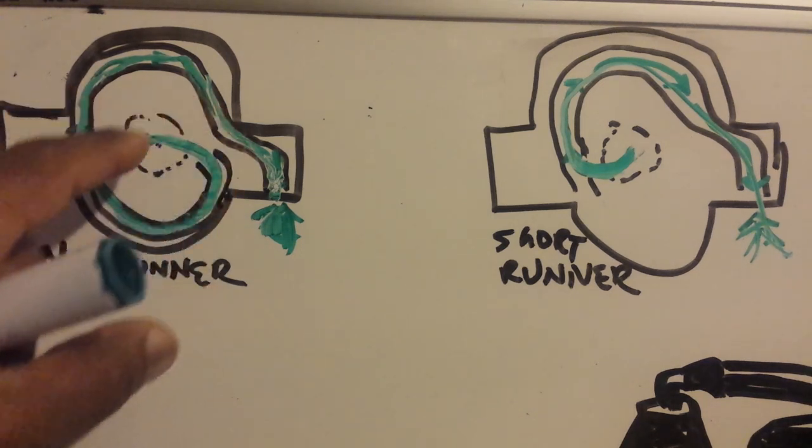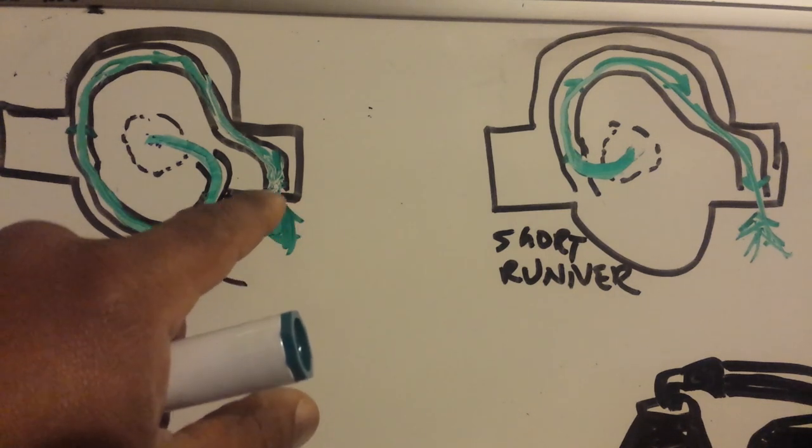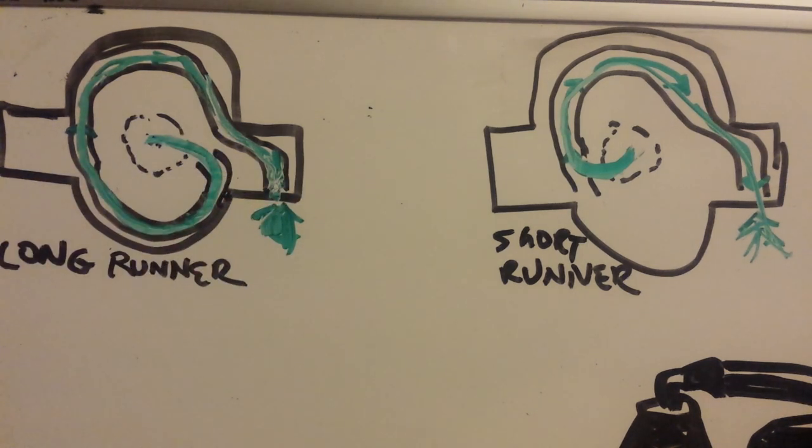And the trick is to have the pressure wave arrive back at the cylinder right when it's needed, right as that valve opens, and that will achieve the most dense possible air mixture passing into the combustion chamber, and it will give you the right amount of fuel to air ratio that will get the car going and will give you the best MPG, miles per gallon, for that motor. This is one of the reasons why you see Mercedes, even though it's a V6 or a V8, you're still getting high miles per gallon. On the SUVs, you're seeing MPGs in the high 20s without any sacrifice in performance.